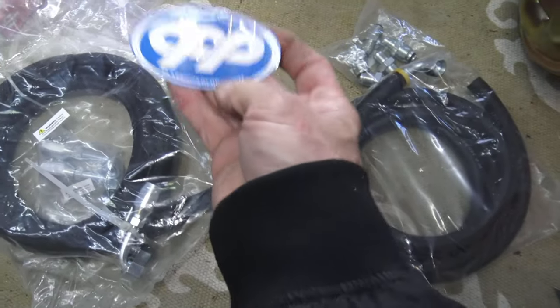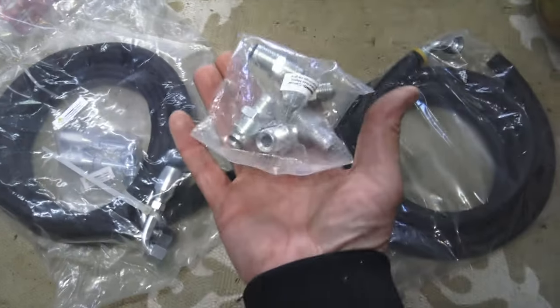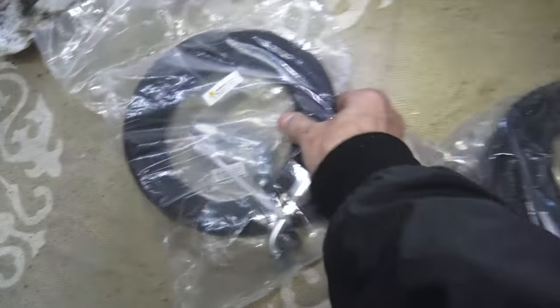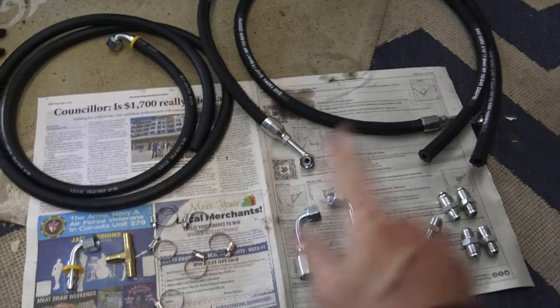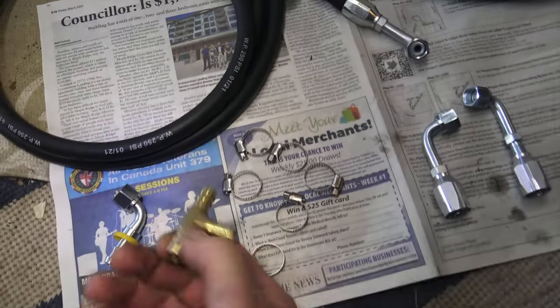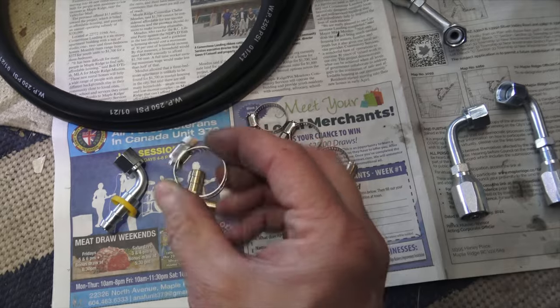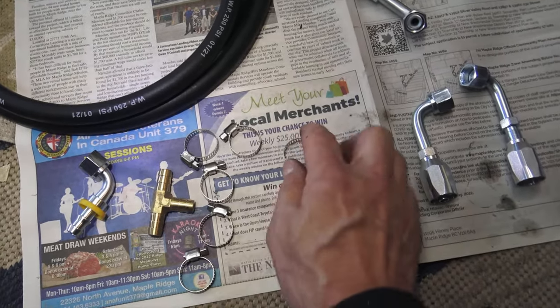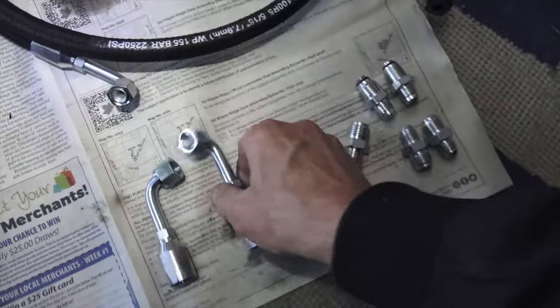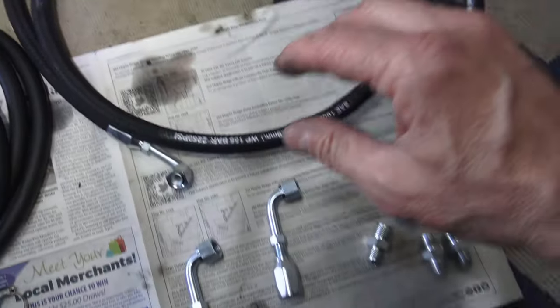Here's my hose kit from Classic Performance — one of the cheapest ways to get a hose kit for this system. I'll put a link below. Here's everything you get: six feet of return hose with one fitting already installed, another fitting, and a T-barb fitting so everything can go into one return line back to the power steering pump from both the hydro boost and the steering box. Because it's low pressure it just requires simple worm clamps. For the high pressure side, you've got two separate hoses about three feet long each. You'll have a high pressure line going from the power steering pump to the hydro boost and then from the hydro boost to your steering box.